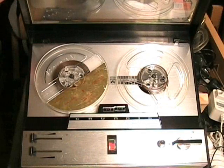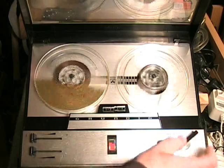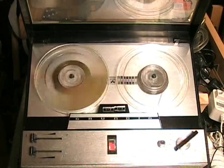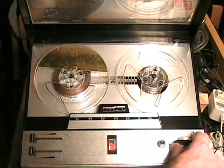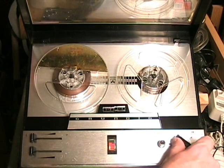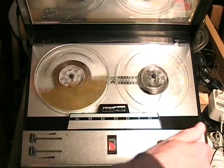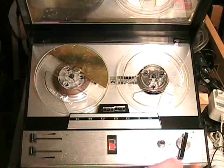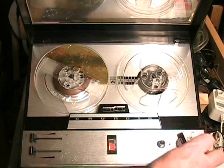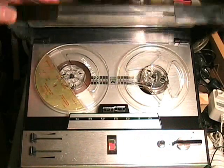We'll very quickly take a look at the rewind and fast-forward functions. For rewind, you simply take this knob and turn it down. To go to fast-forward, you have to go through pause, start, and then fast-forward — so pause, start, another pause, and then finally you're at fast-forward. Then when you push it to pause again, it could play, then pause, then stop. It's a unique control system.